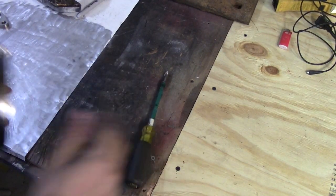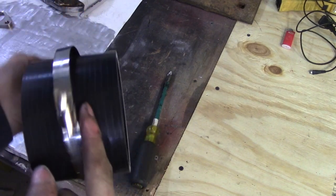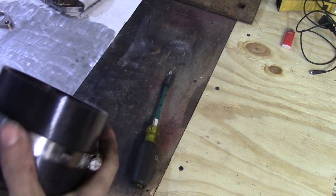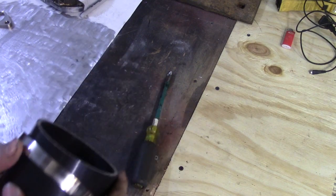The way to cut these down is to take a hose clamp so you can get a straight line with a razor blade. I'm going to do that now — just hose clamp this down to about the size I need, and then cut the piece I need.